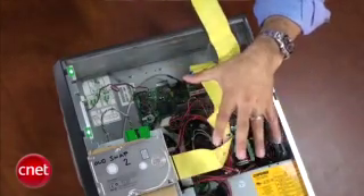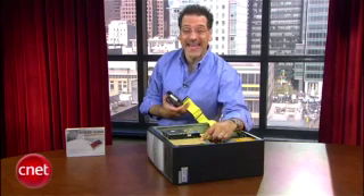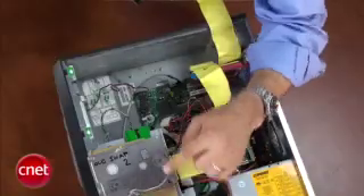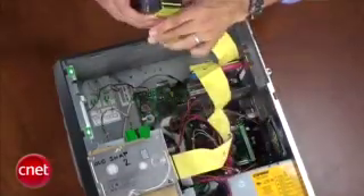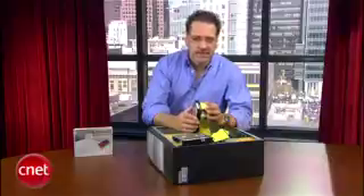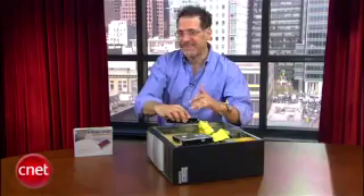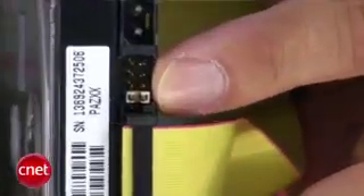Note what I'm doing during the setup: I'm not going to install the drives yet, but I'm going to lay them on a piece of cardboard so we don't get any static or electrical shorts between the drive and the chassis of the machine. Now check the manual or the software that came with your RAID card to see where these jumpers need to be — this is the master-slave cable select thing. Most importantly, the drives need to be set on the same jumper setting.